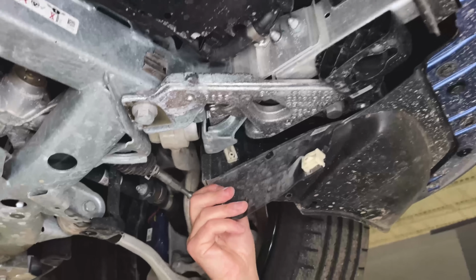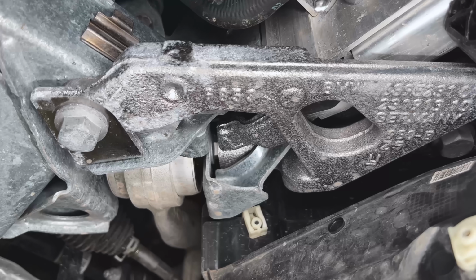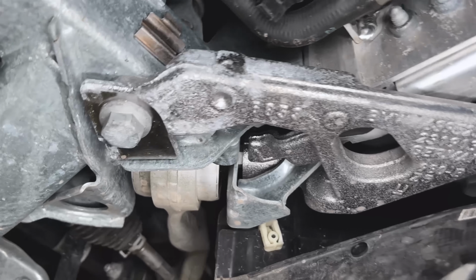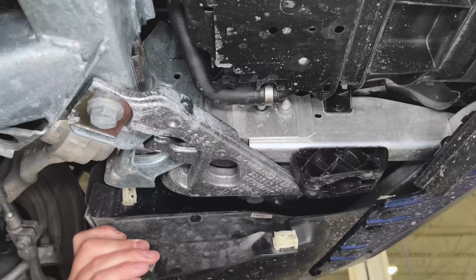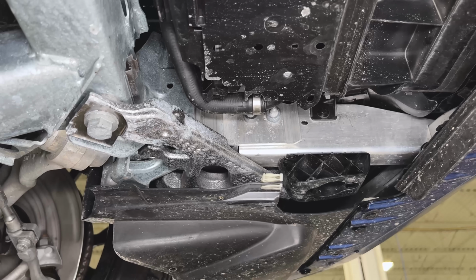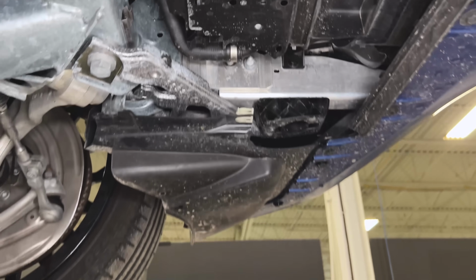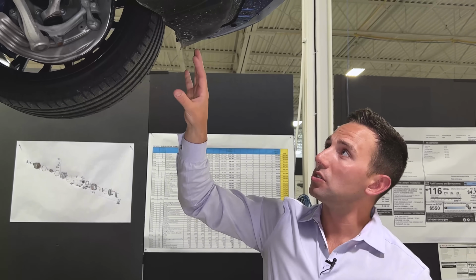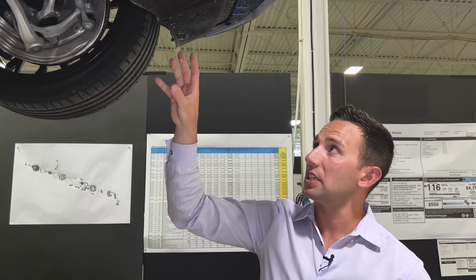So if you see through the camera there, that casting reaches quite far outboard, or towards the side of the vehicle. And it's got a direct structural line to the leading edge of the front lower control arm. So why would you do that? We called them tusks when we saw them on the i3 because that's what they looked like in that case. They were forged.